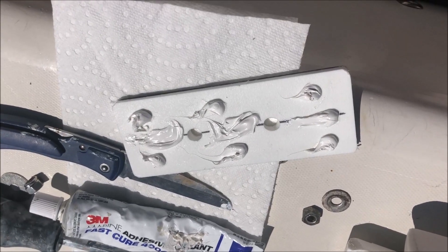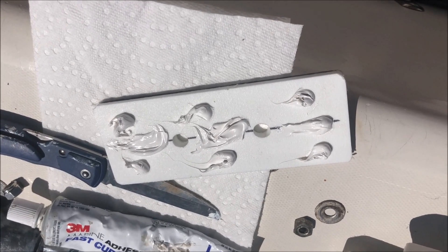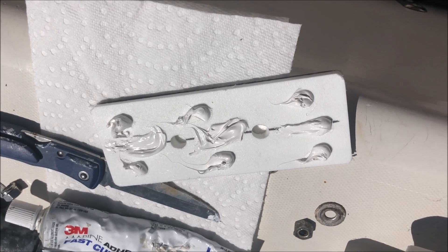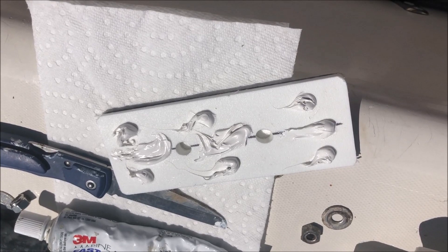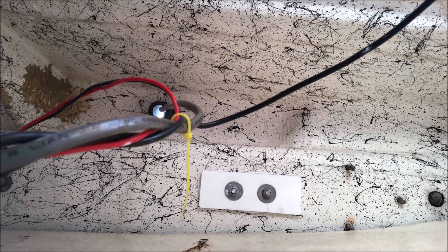This side of the backing plate isn't about sealing. I want the glue here to help spread the load and ensure intimate contact with the backing plate and the deck. So I blobbed on a lot, and I'm going to squish it up there and hold it before I tighten up the screws. From the bottom side, you can see the backing plate and the fender washers. I think we're pretty good to go. Now I need to do the other side.